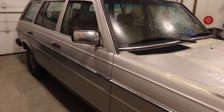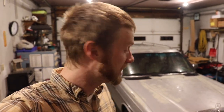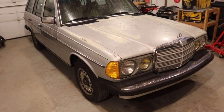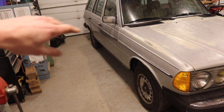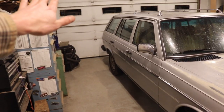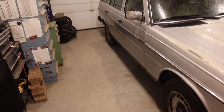There we have it — the Mercedes diesel wagon is back inside. It started sleeting and raining but we got it done. We got the fluid film totally everywhere underneath it that we wanted. Went through pretty much one gallon — could have gone through more if I wasn't rushing. What I did was: first, all the pockets inside the tubing and frame rails, then moved it outside, jacked up the front, got everything with the front jacked up, then backed up on ramps with jack stands for safety and did the same on the rear.